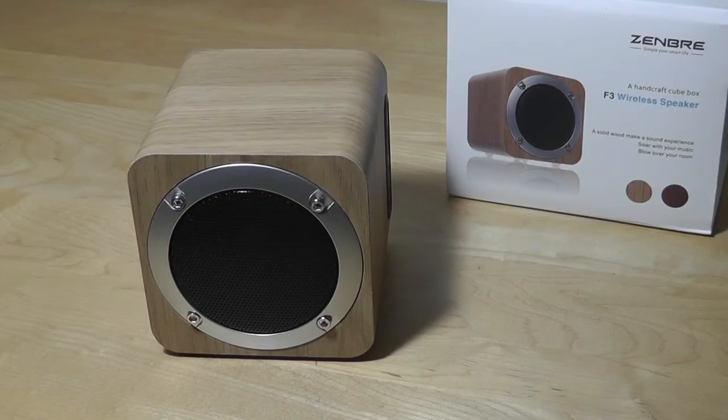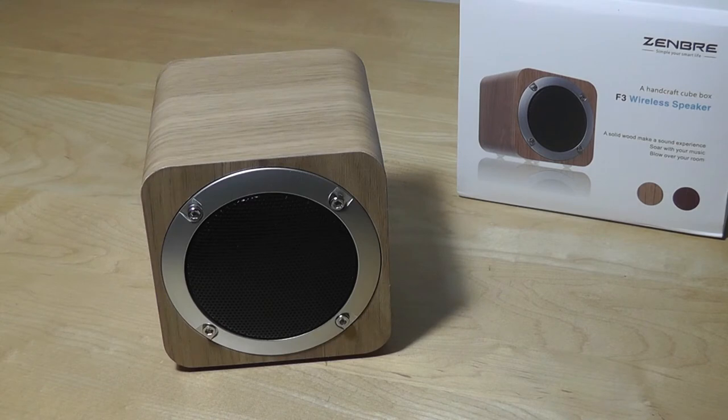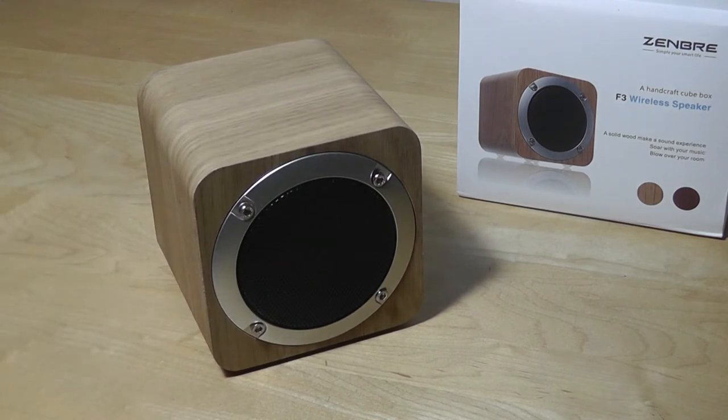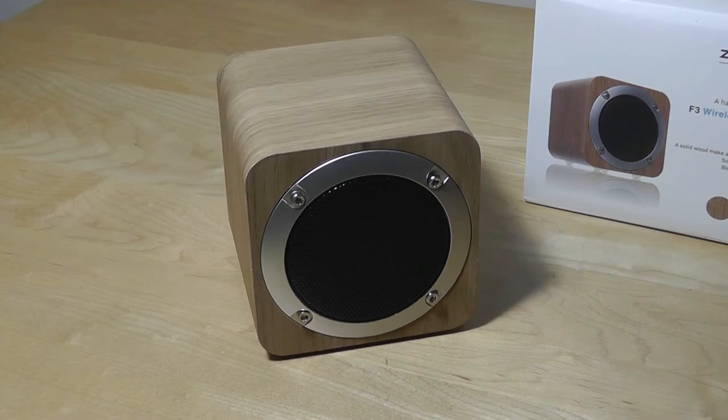Pausing the sample there, the takeaway is the audio quality is good and strong. It has a nice amount of depth to the bass — it's actually quite punchy. There's probably a passive radiator located in the depth of the speaker. Now, it's not the cleanest or most crisp sounding speaker in the world. If you listen closely, especially when you play and pause the sound, there's actually a little bit of static or hissing in the background; it goes away after a few seconds. Overall, if you're listening to pop music or even EDM music where you'll notice the bass drop in the lower frequencies, the F3 actually does a pretty good job. It packs a six-watt single driver, so it is quite powerful.